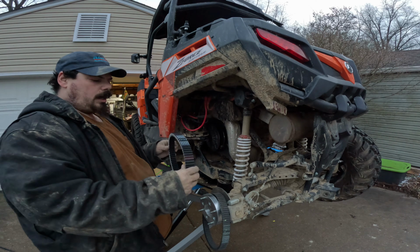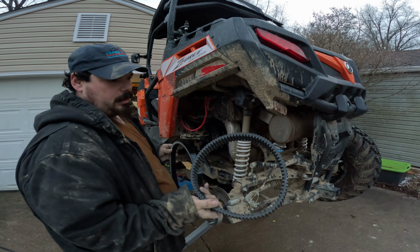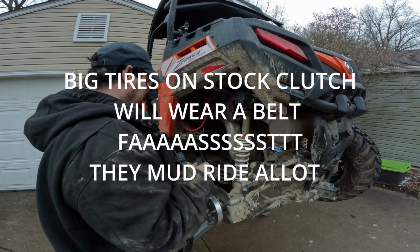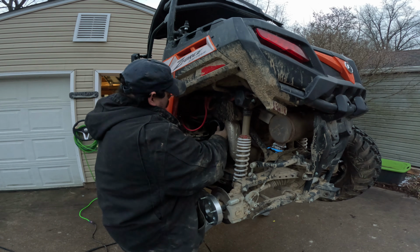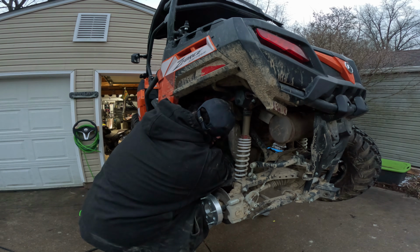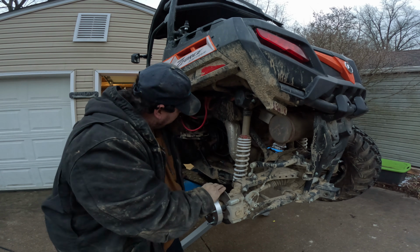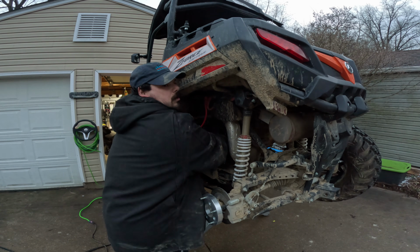Everything looks good. All right, guys. So they did opt in for a new belt. Theirs is quite worn. Maybe we'll save this for a video if they don't want it and toss it in the bed there. We did find some wires in here. So let's go ahead and fit this belt up in here. Now we just bring this belt out there like so, and then push this in. Then what we're gonna do is take our spreader bolt right back out.